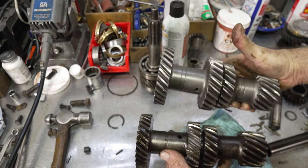Alright, so here we have that main shaft and as you can see it is twisted. There's a nice twist in it - kind of starts right about here and then works its way down. I've got a brand new yoke here and I want to show you - if I put this yoke on it just stops right where the twist is. So a lot of times people are buying these transmissions, they put a yoke in the back and it doesn't go in all the way - it's because the main shaft is actually twisted. Oftentimes the yoke will actually twist with the main shaft, so it's better to keep the old yoke with it.